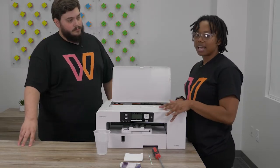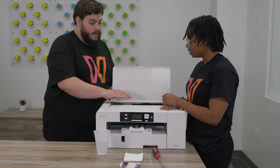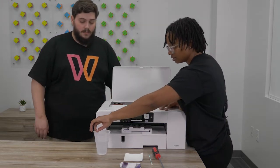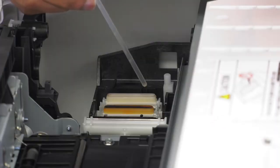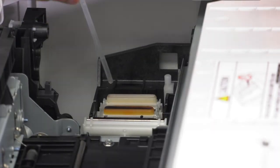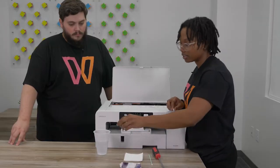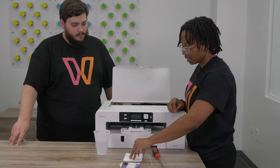Then you have the extended clean, which is about six to eight hours. You leave the hot distilled water in the station and move your print head so it's covering the capping station, allowing the heads to rest gently against it as it soaks. In between those six to eight hours, you can add fresh hot water so it's really absorbing all that excess ink and cleaning it out.